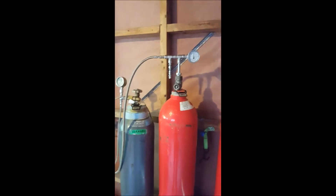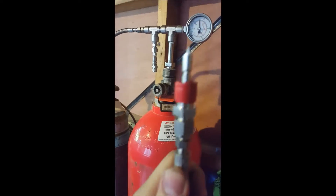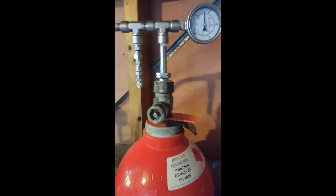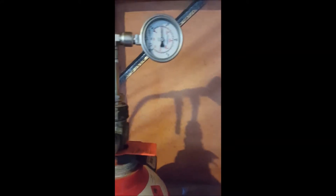How do I fill it with hydrogen? That's even simpler. On my hydrogen bottle I've got a gauge, a bleed valve, and a little filling barb. I slide this socket on — just like so — turn the ignition on because it needs to energize the in-tank regulator valve, then crack the bottle. Hydrogen gas flows, and when the pressure drops and stabilizes, it's as full as it's going to be.